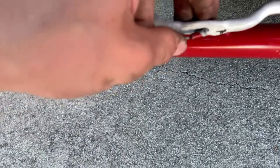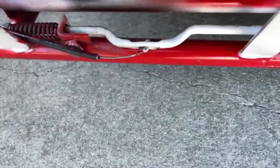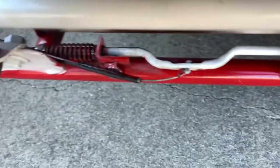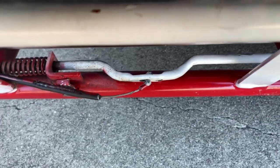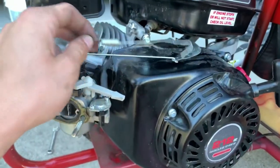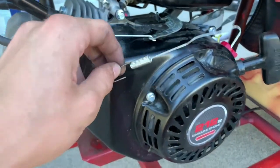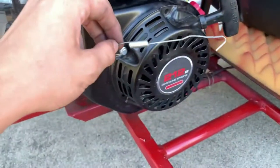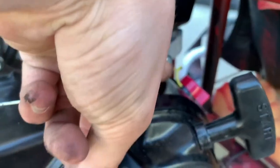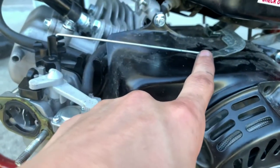When you press the throttle down, it'll pull the cable slightly. Since this engine isn't a normal engine, this is also showing you how to reroute the throttle to have no governor. You'll take a spring like this, which came with my old engine, and hook it up through one of these so that when you're not on full throttle it brings it back to just idling again.